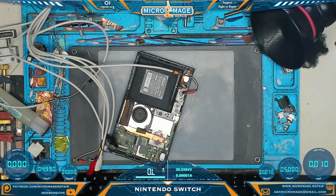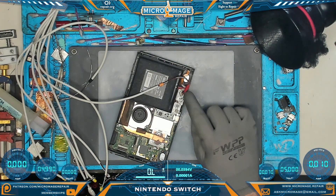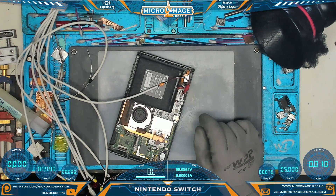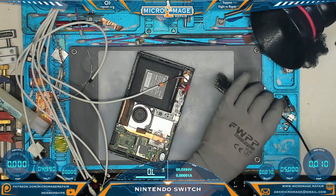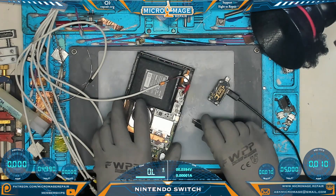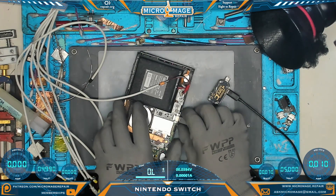Let's try something a little out of the ordinary. I've hooked up my modified iPhone power squid, retrofitted with Nintendo Switch and Switch Lite battery connectors. I'm going to prompt it to boot using the OEM charger, then check if it's in RCM — it may be a case of the battery being too dead to tell us. Still not seeing RCM.